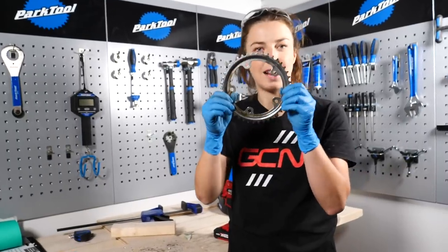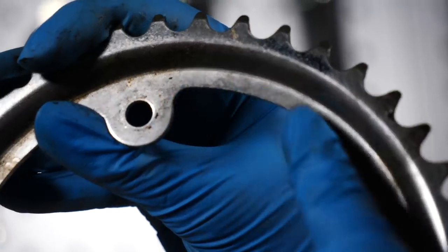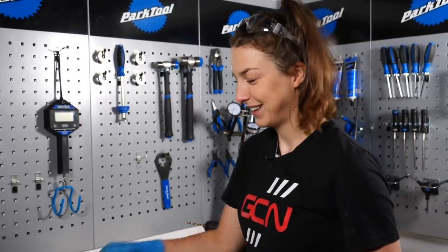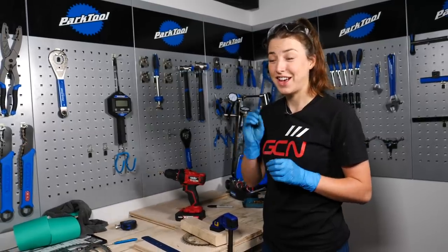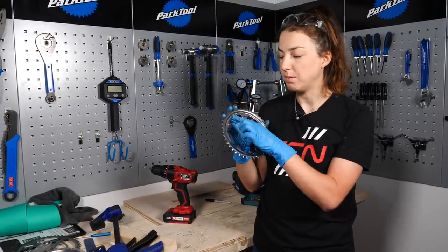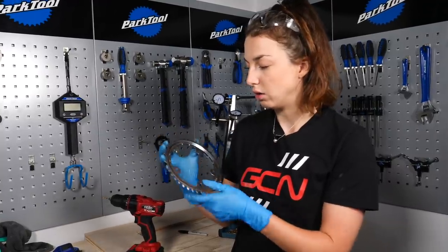Next up, our victim is the little ring. For this, I'm going on the very inner bit and I'm going to change the drill bit to a slightly smaller size. I'm going to do obviously a lot less holes on this one because the chain ring is a vital part of the bike. So I'm going to drill two holes in between each of the big holes — 10 holes on here in total — and this metal is quite a bit thicker and tougher than the old basher. My drilling skills are not the best, and I've just proven that by going very close to the edge. I think I'm going to add another hole in between each hole I've already done. I think it could cope with that.